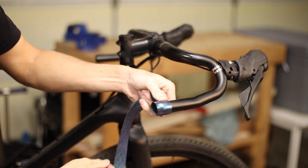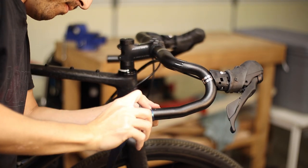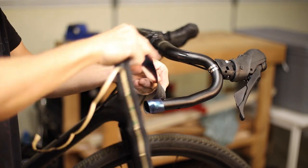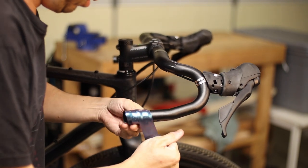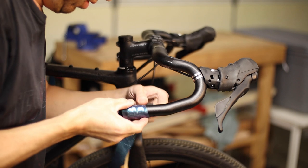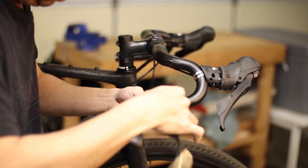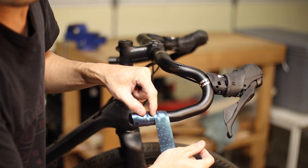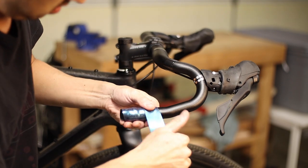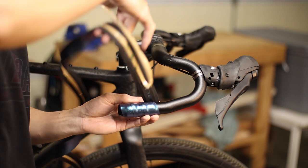Looking from the back of the bike towards the front on the right hand side of the handlebar, go in a counterclockwise direction such that as you come over the top of the handlebar the tape is being pulled away from the bike. As you start wrapping, don't be afraid to pull the tape pretty taut — it takes a lot of force to tear bar tape and you definitely don't want your tape to come loose. Overlap the previous revolution by about one-third of the width of the tape. You can increase the overlap for a thicker wrap or reduce it for a thinner feeling grip.